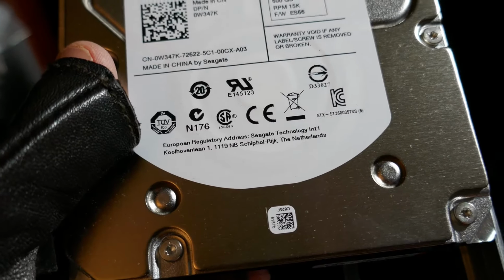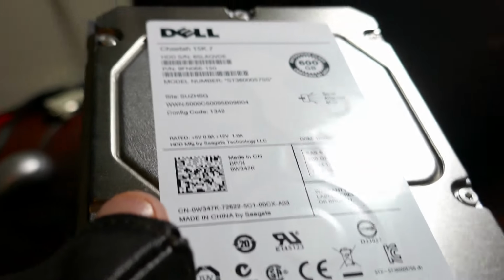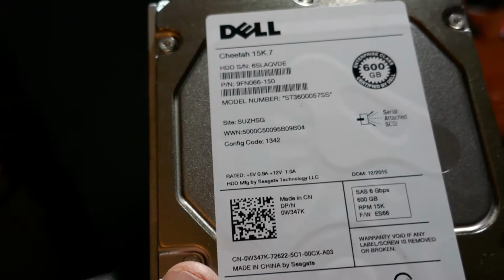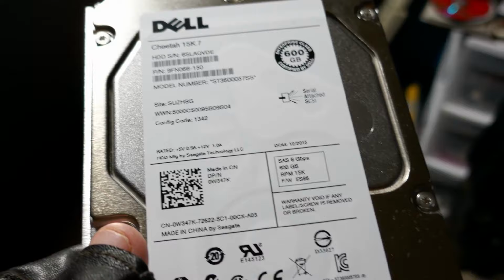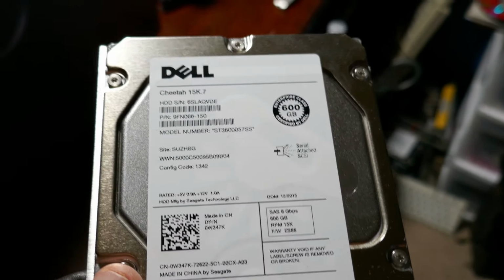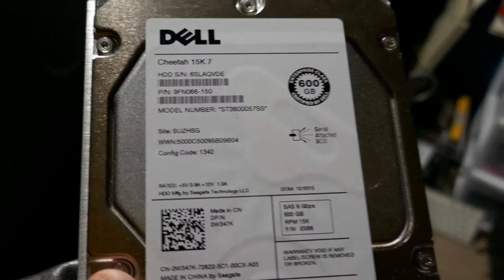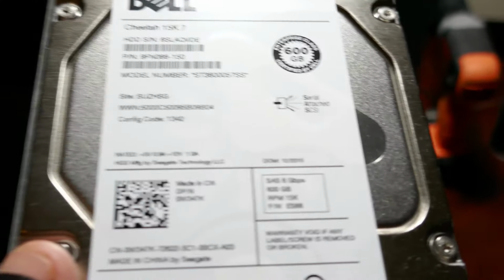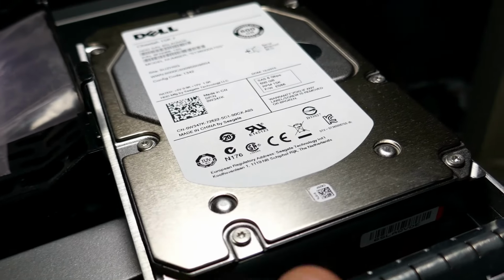And I'm not exactly sure why, but it's only got a gig of storage. Now I know with a RAID 5 you're reducing your total capacity, but I mean, this should be 2.4 terabytes minus the RAID 5 configuration. I would have thought 1.5 terabytes. 600 gig, these are probably like 500 something formatted, but I would have thought 1.5 once they're formatted in the RAID 5 configuration, somewhere around in there. But no, it's only a gig, so I'm guessing it wasn't fully partitioned.